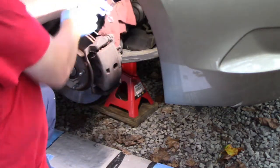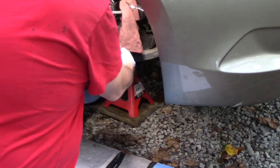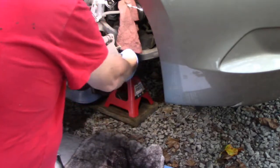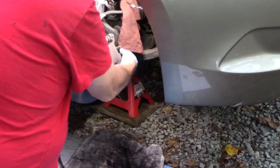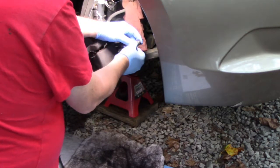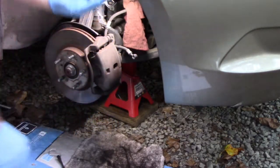I've got it clamped with a rag so I don't damage the brake line. There'll be two washers. The banjo bolt is a little different than the rest of the bolts because it has an actual hole in it, with a washer on each side, and that hole permits the fluid to travel through.